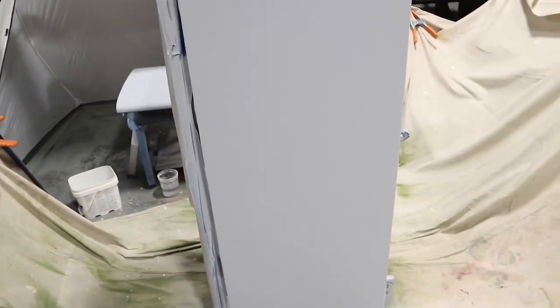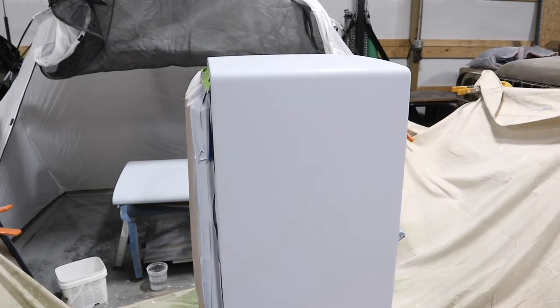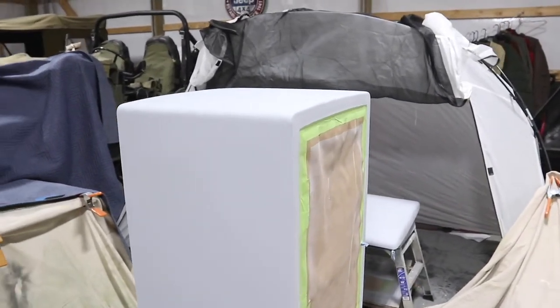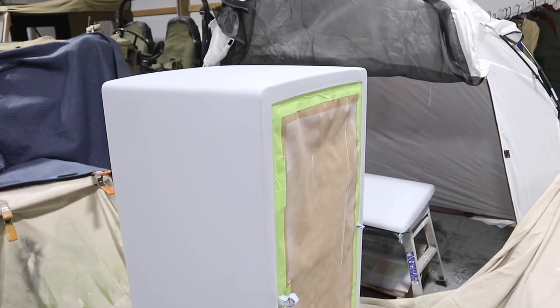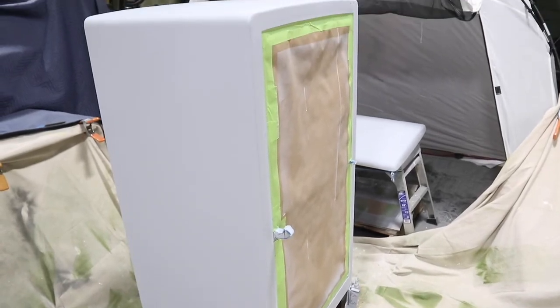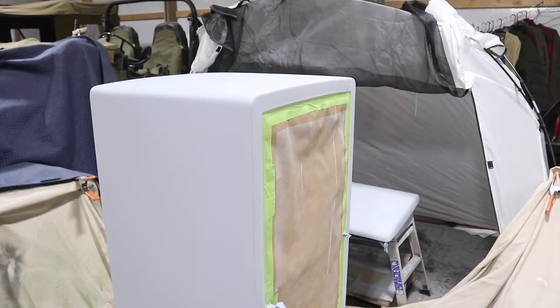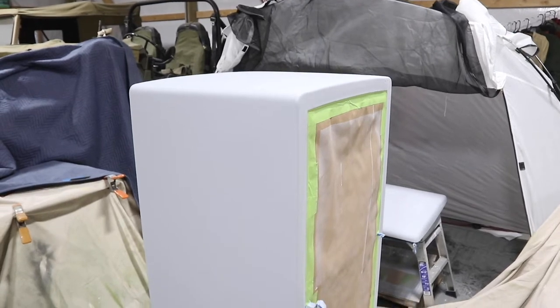In the last clip I told you that with the primer I could see a couple more imperfections I wanted to fix up. There are a couple spots where I've added some bondo that I've got to come back and sand. The first two coats of primer are on and we've got it sanded to 1500. Once I get that bondo addressed, I'll put another coat, sand to 1500, put another coat, and sand to 2500, then start with the final paint color. I also had to retape and repaper — I switched from regular painters tape to automotive masking tape with maximum adhesion from AutoZone and it's doing a much better job.